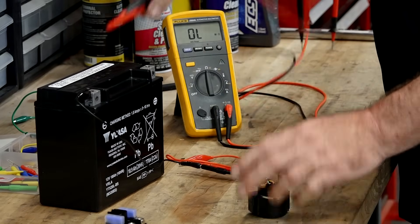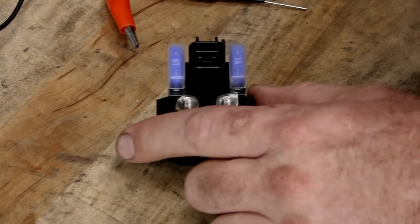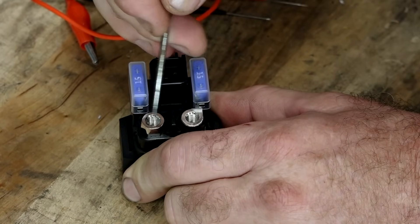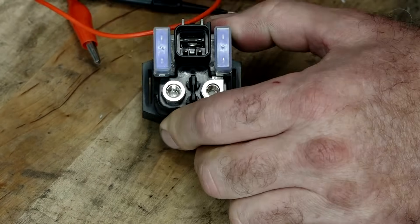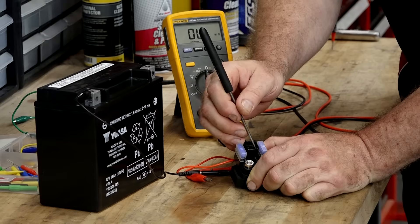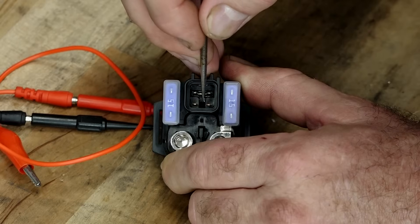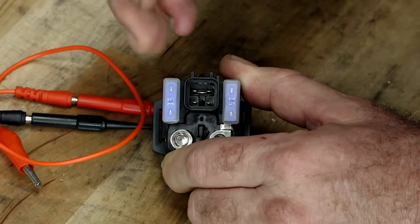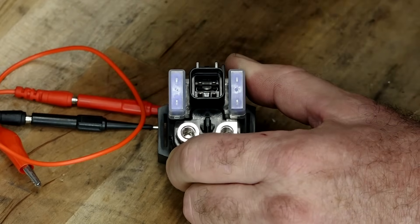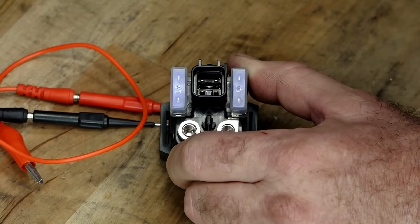Now let's look at this other example I have here. It accomplishes the same thing — a low circuit connecting a high circuit — and there's going to be your two posts. The trick with this one is there are actually four connections that can be made inside of it. So what you're looking for is that coil. What you're going to find is there's two that are going to be for the coil itself, and the other one is basically a connection back to your battery post that's going out to your electrical distribution system, also known as your fuse box if it has one.